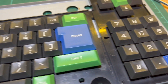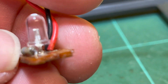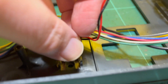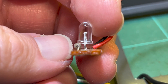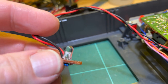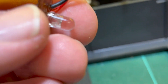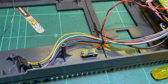Keyboard all nice and clean, ready to go back into the case with the data set. Before I can put the keyboard back in I need to remount the power LED. I've gone down as far as I can but it's still just too high because it's sitting on the limiting resistor, so I'm going to get rid of that resistor and mount it underneath so I can drop the LED down a little more and it should just fit in. I've changed it to a 100 ohm resistor — the other one was maybe 300 or something. It should now fit, and it's in. Okay, time for the keyboard!